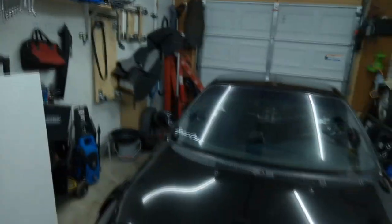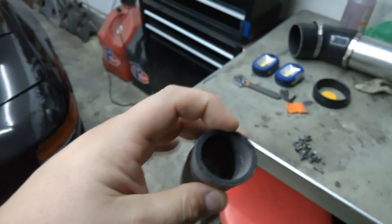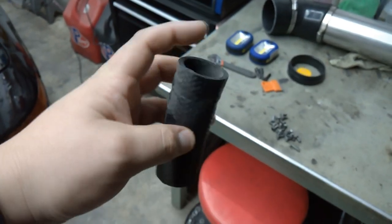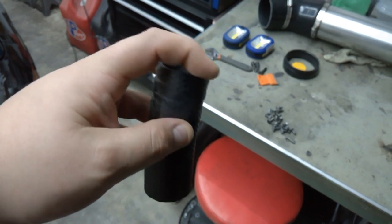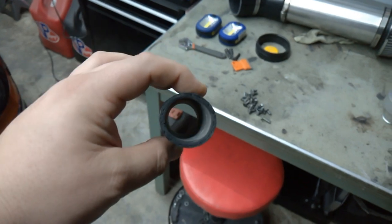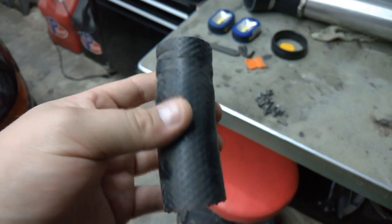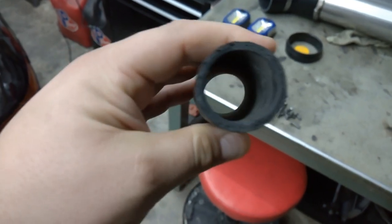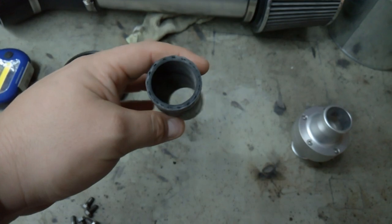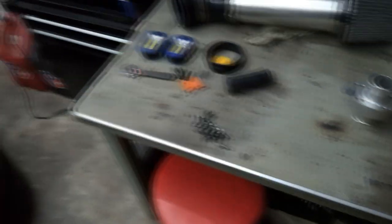Another thing I wanted to try — here's a piece of hose, so this is like radiator hose — I'm going to try to get a long piece of steel stock that fits inside here that I can actually weld a disc inside with a hole, to sort of restrict flow. Not too much, I don't want it to be too crazy, but maybe like a 10 or 8mm sized hole. I'll probably figure out whether I'm going to do that yet — it's just something I read online.